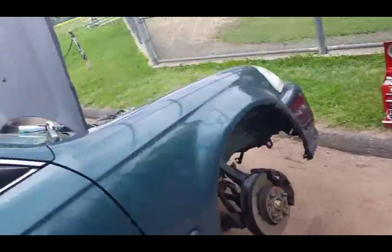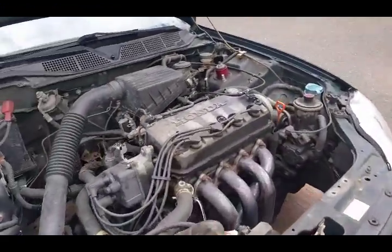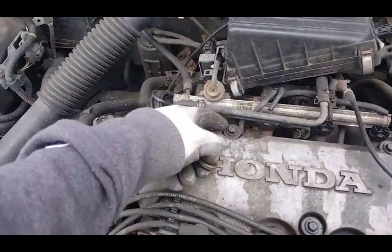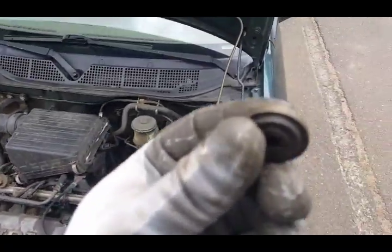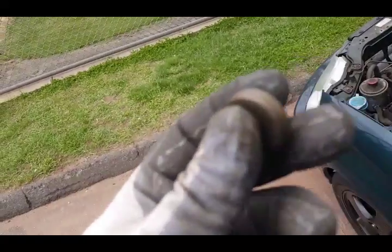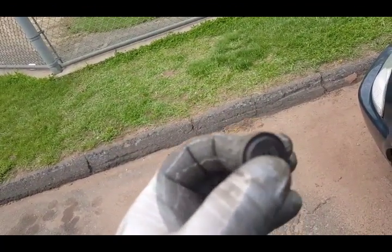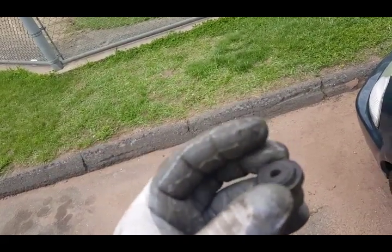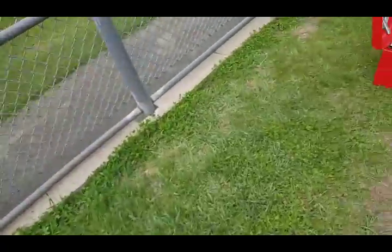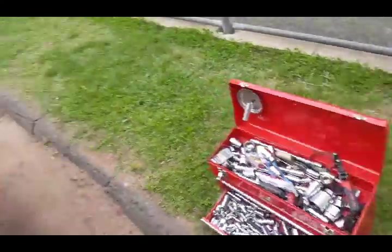For that washer, what I actually used is one of these, which you usually see right here on top of the valve cover, and it's got a rubber bushing at the end. So hold on one second. So if you take this and put it in there, it won't be necessarily solid, because you've got this rubber bushing on one side, and I made sure that this rubber bushing was contacting the shifter, so I still have nice and smooth motion back and forth, and it won't be clinging.